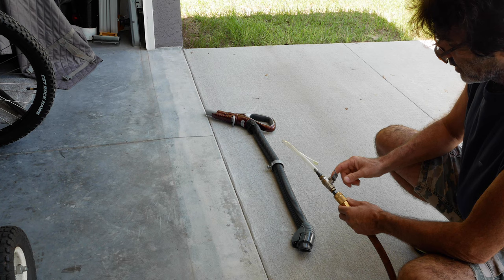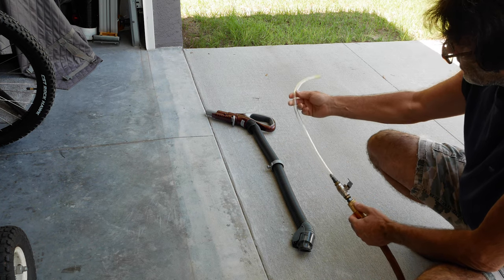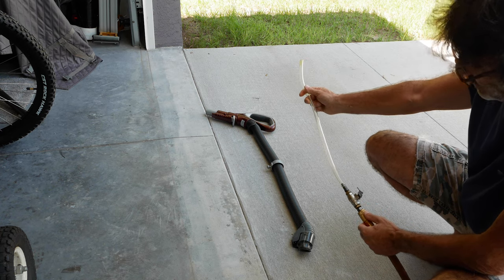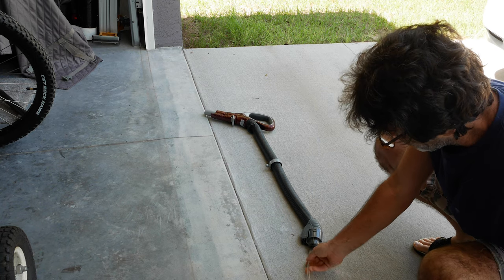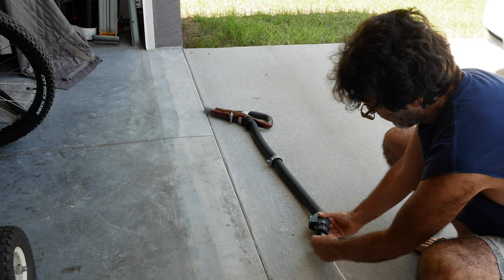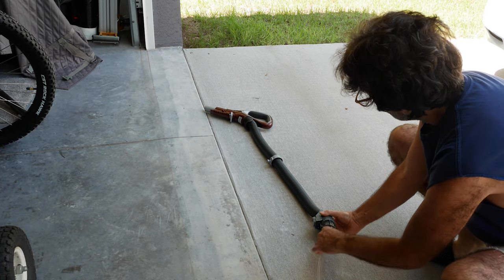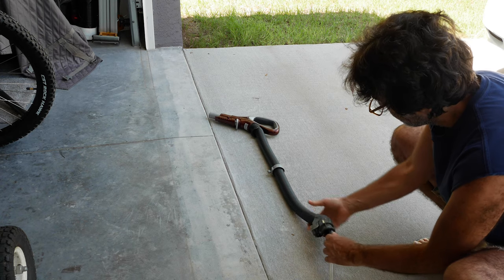What I've got here is an air compressor with a blow nozzle on it. I've extended the blow nozzle because the end is too big to go up inside the hose. If you don't have an air compressor, you can probably push water through there and that will push the clog out — but if you do that, make sure to let it dry. Since we have an air compressor available, we're going to use that.